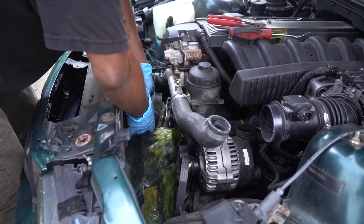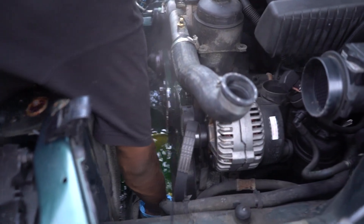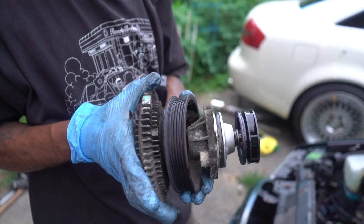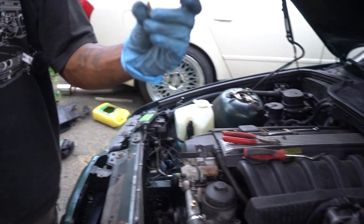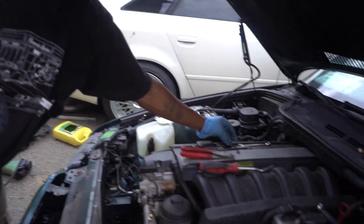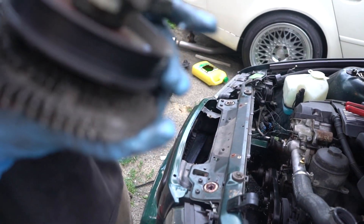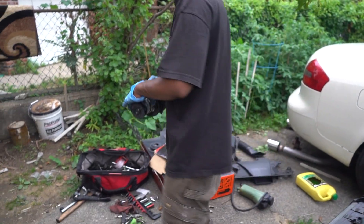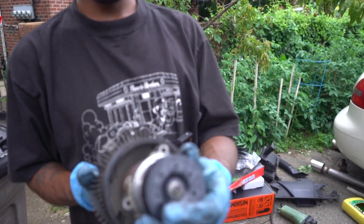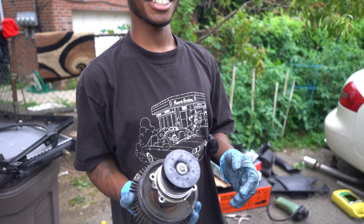It's about to come out — the drain pan didn't even do its job. We got it out. As we were loosening all the bolts we noticed that one had seen better days — it's actually cracking — so it's a good thing we're doing this, because Kyle would have slipped the belt and lost power steering. Also the old water pump has plastic propellers that look warped, and if that breaks it goes inside the engine, so you definitely don't want that.